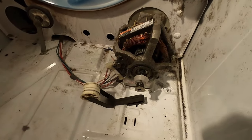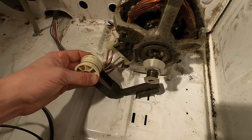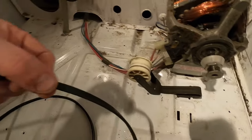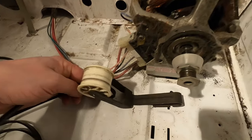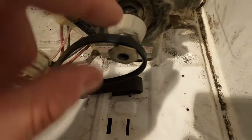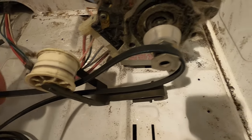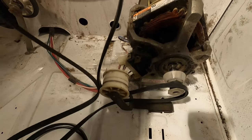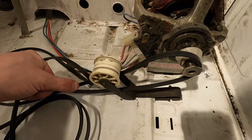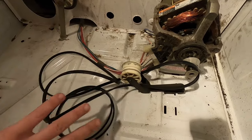I'm ready to reinstall. This is the trickiest part of this job, which isn't even that tricky. Before I put the drum in, I want to show you with the drum out. You take your tensioner pulley and it locks in just like this, then you take your belt and pop it in this way. Make sure you wrap the belt around with the rib side on the motor shaft right here, and then as you pull this up around the drum, this goes around the top of the drum and this goes on the bottom.